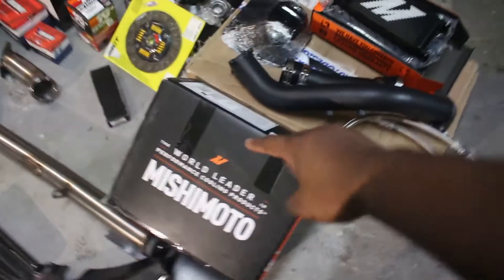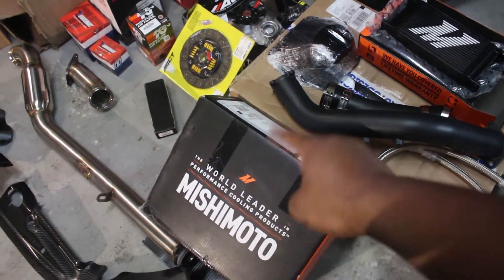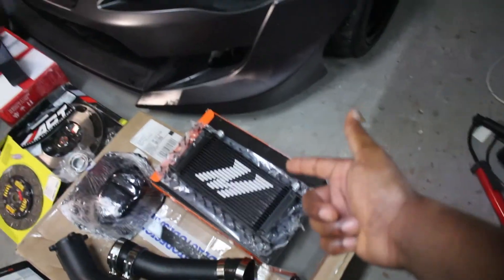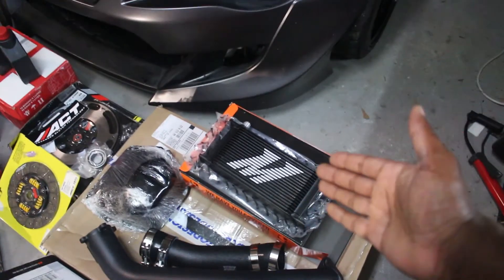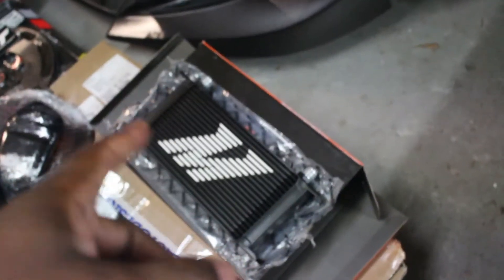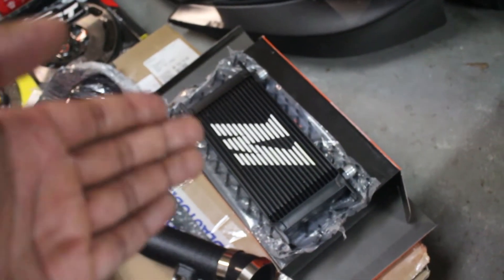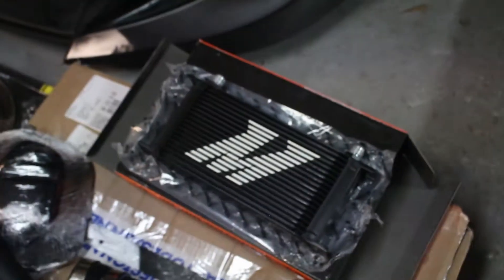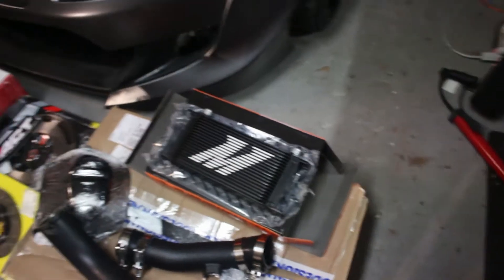Moving over, I have a couple of Mishimoto parts. In the box there's a Mishimoto oil-air separator, and also an oil cooler kit - the non-thermostatic version, because it stays pretty hot here in Georgia year-round and I didn't feel I needed the thermostatic version. Plus, this one was on sale - they retail for over $500 and I got it for about $250. Since the car will be boosted and running hotter, I want the oil to stay as cool as possible, so it's kind of a necessity given where I live.